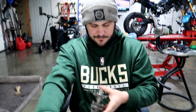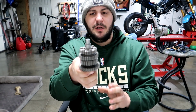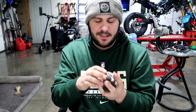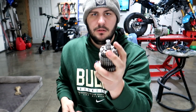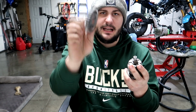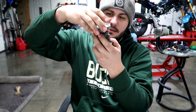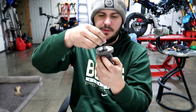Next, we have our counter shaft, which is where the sprocket goes on. And we are going to be installing the parts we took out of the stock transmission onto here. So we have our thrust washer, which is going to go on first, and then the spacer, and then the Takegawa 5th gear that they give you. So this is just going to sit onto here like this, and then we put our final D-washer onto it.